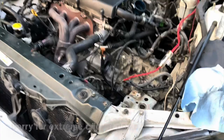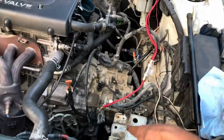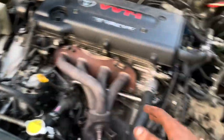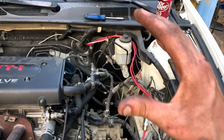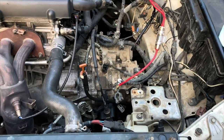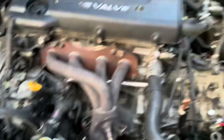There's really not much information on the internet or YouTube about swapping a transmission on this car. There was one guy who unbolted half the subframe - three bolts - and used a scissor jack to spread the subframe from the vehicle and pulled the transmission out from the side. It seems like a sketchy but easy way to do it, if you don't consider that the transmission weighs around 200 pounds.